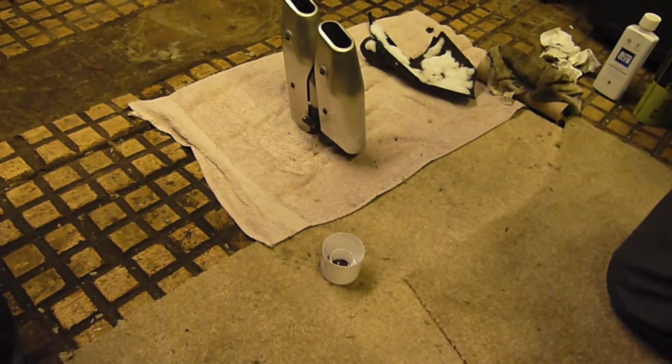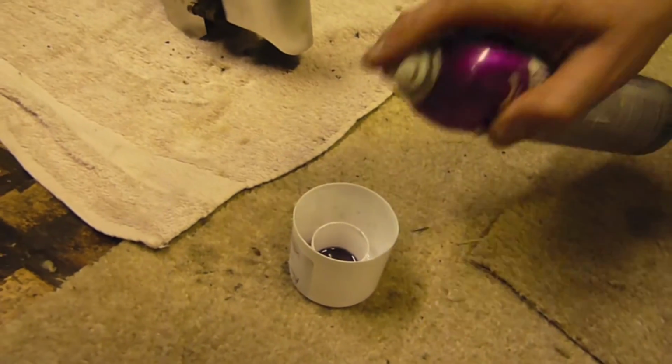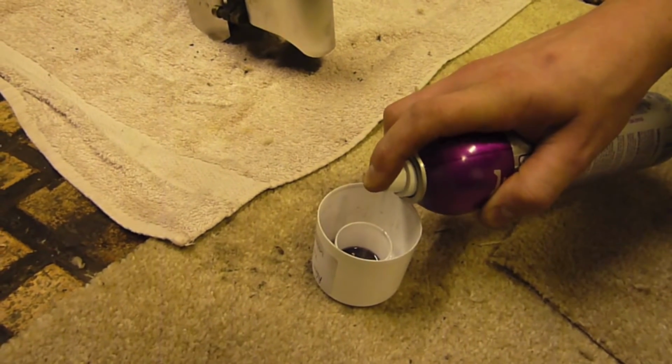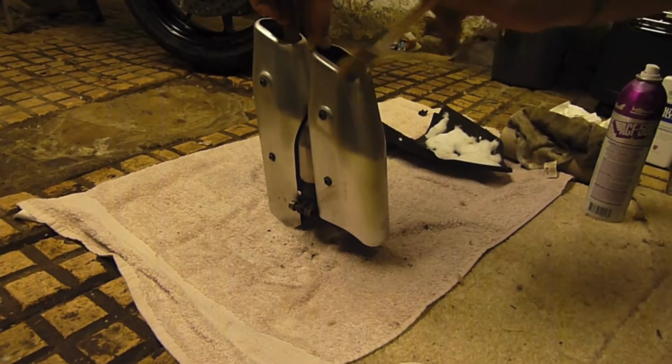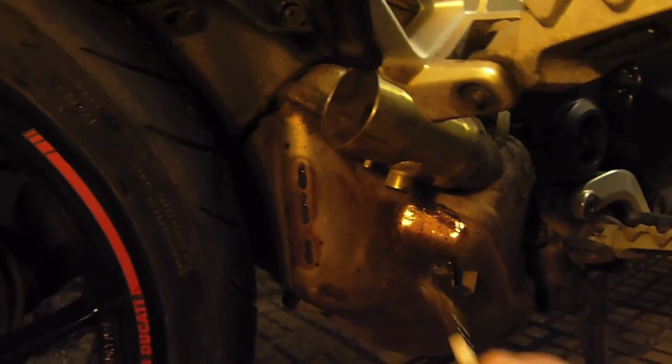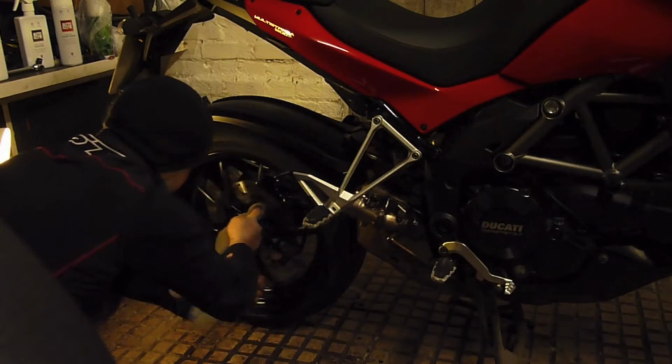With that aside, you're going to want to use a new paintbrush to apply the ACF50 to your bike's metal parts. Holding the can horizontally and lightly depressing the cap will squirt out a liquid rather than a spray. Aim this into the lid and dab the brush in. Coat every surface of your engine, exhaust headers, end can, switch gears, lever pivot points but not the actual levers, and your swing arm, etc. Get the underside of your foot pegs but not the tops.